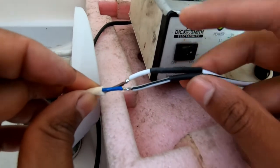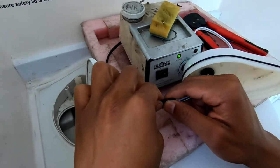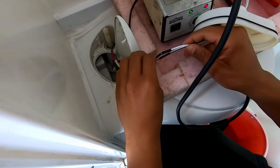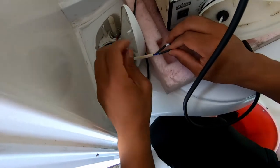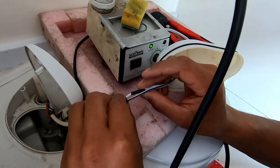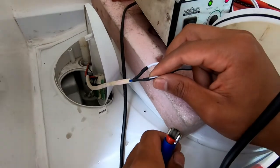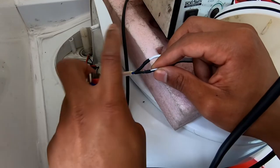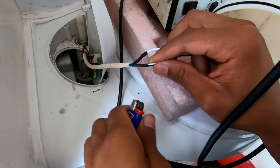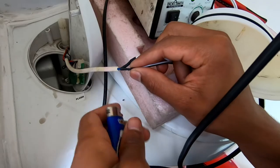Once that's soldered, go ahead and slot your heat shrink on and completely insulate it. Again, make sure your power is off before you do any of this. If you don't have access to turning it off, remove that fuse I showed you earlier — that way you know 100% there will be no power. I use a lighter here because you don't want excessive heat coming anywhere near the PCB, the plastic of the toilet, or the wiring loom. I normally use a heat gun but given we're in a confined space, a lighter is safer as you can control the flame to heat the heat shrink. If you're using crimp terminals, you won't need any of this.